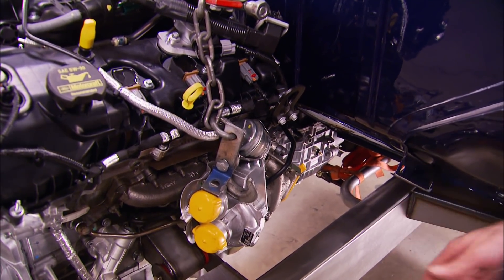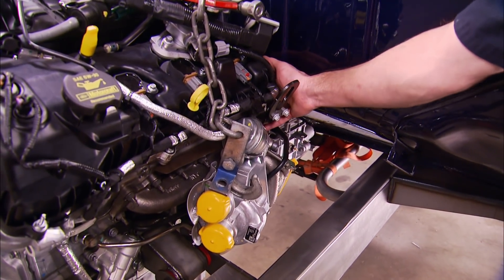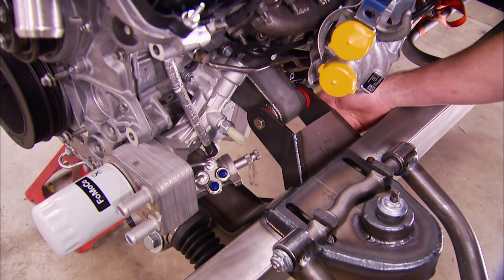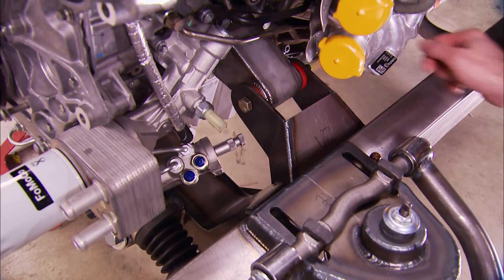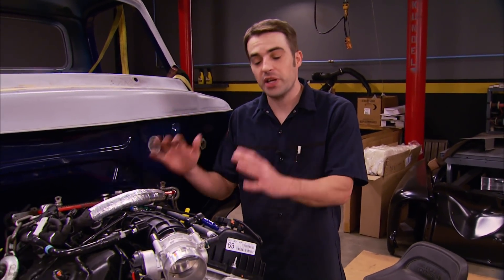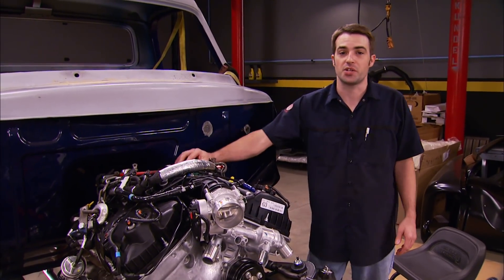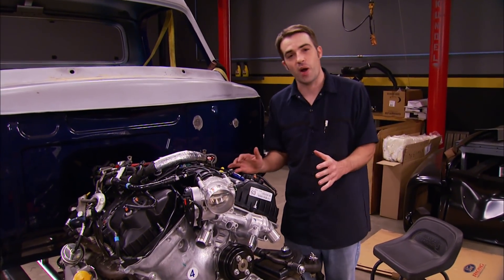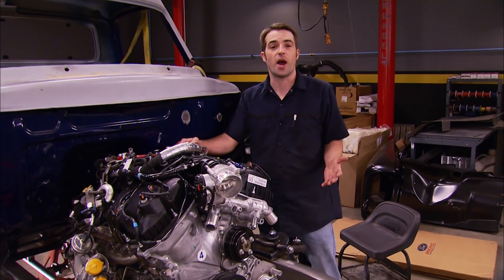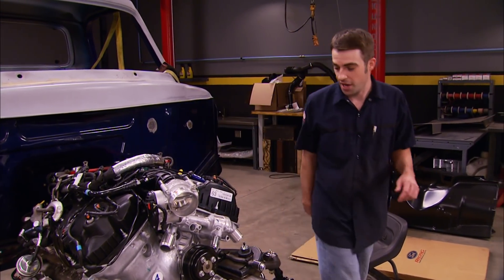For firewall clearance, we have about an inch and a half between it and the back of the cylinder head, so we should be in good shape there. For the steering shaft, I just designed the engine mount so the shaft didn't run into it. With the engine placement pretty much figured out, I'm really glad we went with this smaller V6 and five-speed manual transmission. It didn't require any modifications to our old 55 to get this drivetrain to fit — it's just going to require some custom mounts. So let's get started on that other side.